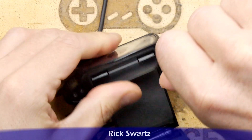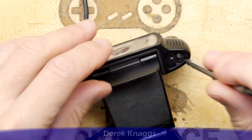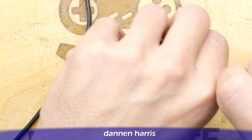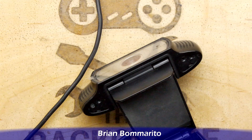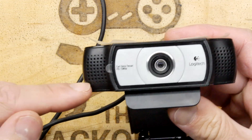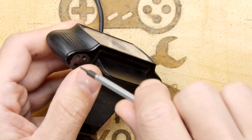I'm hoping I can figure out how to adjust the lens in here. It does have an auto-focusing system so I need to be a little careful, but most cameras I've opened up tend to have a circular ring you can just twist. You can see I'm pulling these clips off the bottom. The other models — I can't remember the numbers, maybe C920 — I think this is the C930 — you can push a pin in and pull the grill off that way. Let's have a look inside.